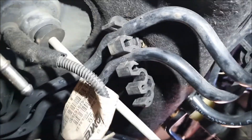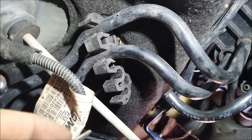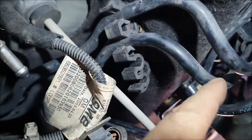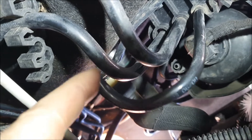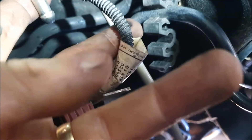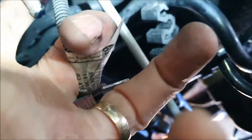Now I'm going to push the hose on - there, there, there. Now I'm going to get the lighty hose between here and here. If it doesn't break again I'll just clamp it off, otherwise I'm going to have to replace it all the way up to the bottom of the differential pressure sensor up there, which means taking the scuttle off - which I'm trying to avoid. So just bend this back out a bit.